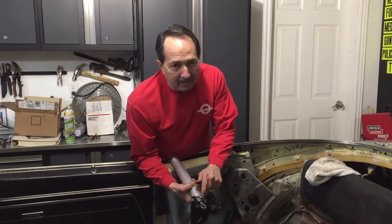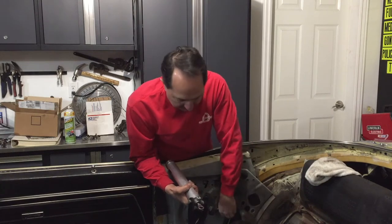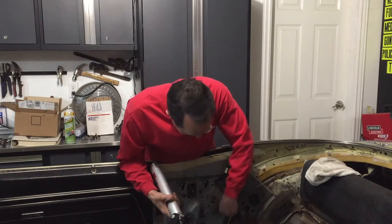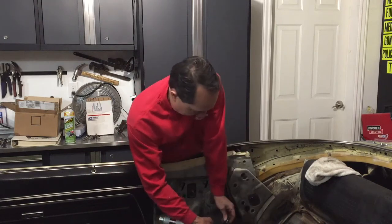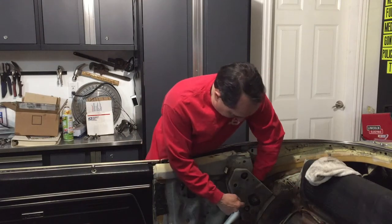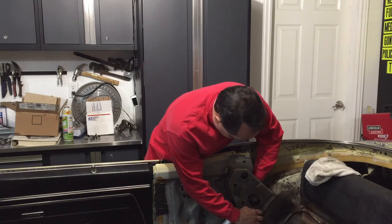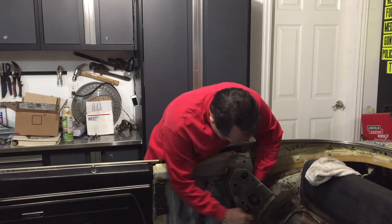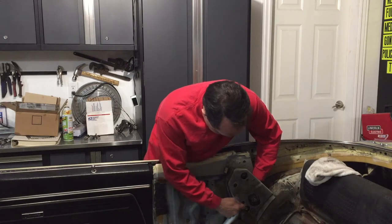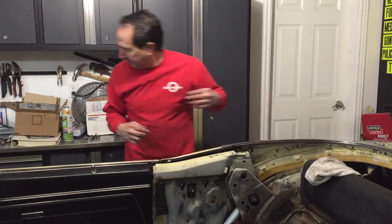These fittings are aluminum, so you really want to be careful not to get them cross-threaded or tighten them down too much and strip them — that'll void the warranty. I'll make sure the o-ring is in there. What I'm going to do is tighten these up and try to get them exactly where they were before. Luckily there's enough dirt residue and scuffing on the finish to know exactly where those came out of.